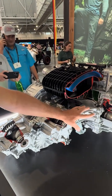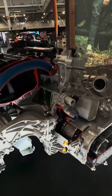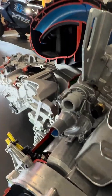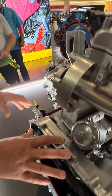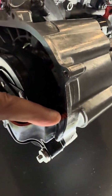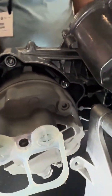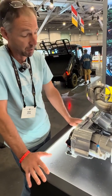Coming around — specs: 1700 watt stator. That's a little bit over double what they were for the Defender, so that's a great upgrade, especially with all these Defenders now running AC, fan motors, the controls to them, and big stereo tops. The old Defender motor had a little plastic cover but it was an open design. Now this is completely sealed. For the guys wanting the Limiteds to go mud bogging, you've got a big thick rubber gasket and plenty of bolts to keep it clamped tight. The compressor's sealed from the back — all this will be watertight to keep the belt sealed out of the elements. They really went a long ways to make the AC work in the environment which this unit is built to perform in.